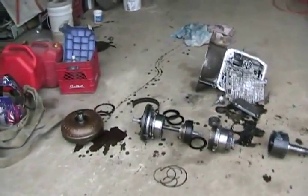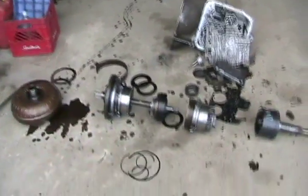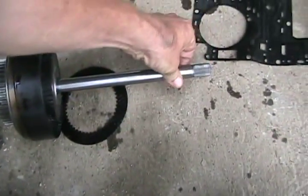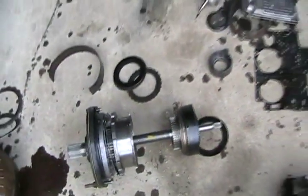Now that I've got this whole thing torn apart on the floor, the disassembly process — once I got the front housing off — everything else was just held in there by a few C-clips. The reason you check your transmission oil while it's running is because it has to fill up the torque converter to show the right level in the oil pan. If your engine is not running, half of the oil from the torque converter runs into the transmission pan and the level goes up. If your transmission isn't working at all — every gear you select, the car doesn't move — the first thing to check is the fluid level. If it still has fluid, check it once while it's running and once while it's not running. If the level is the same, the most common problem is the pump shaft — this skinny shaft has broken or the teeth have stripped off, so the transmission is not sucking up the oil. This is a common problem for mid-1990s Cavaliers and Sunbirds.